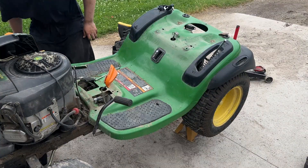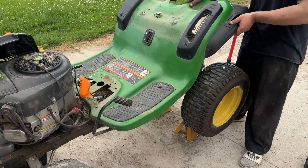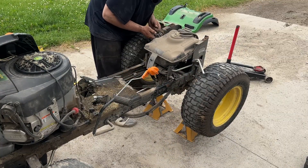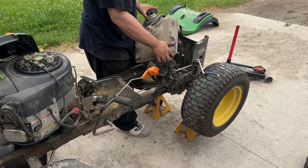Disconnect the parking brake harness. Before lifting this up — note that in this video I do not show me taking off the spring for the cruise control. Make sure to disconnect that safely and reapply that spring whenever we put it back on. Now we have to detach the springs for the gas tank, and once that's completed, it comes out as one.